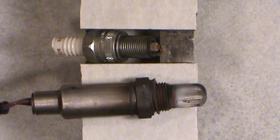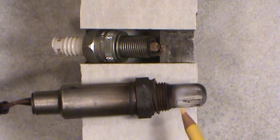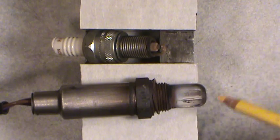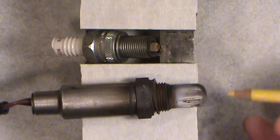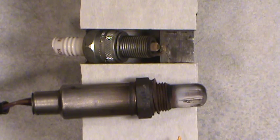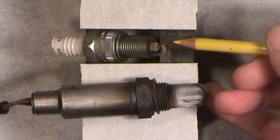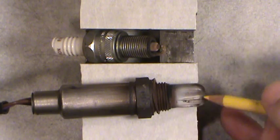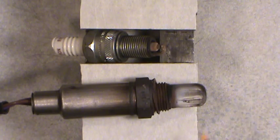So then I started thinking about the oxygen sensor. This isn't the one I'll be showing you in a few minutes — this is one I used in another video and I cooked this tip with a propane torch. That's the deposit you actually see on this covering around the actual sensor element inside the oxygen sensor. This particular vehicle just uses one oxygen sensor pre-cat, or in other words, one oxygen sensor just before the catalytic converter. What I'm trying to show you here is the correlation between deposits on spark plugs and what they might look like on an oxygen sensor as the exhaust stream passes the sensor tip while it's in the exhaust system inside the pipe.